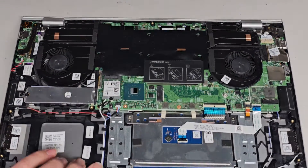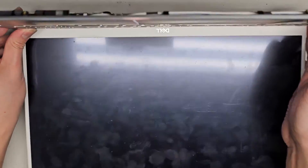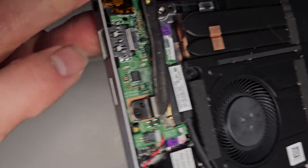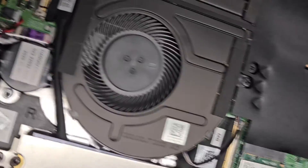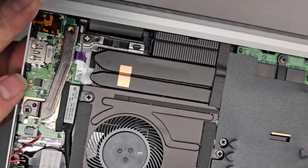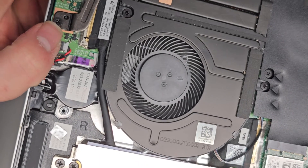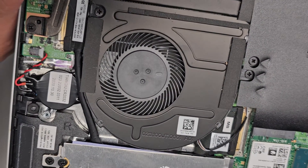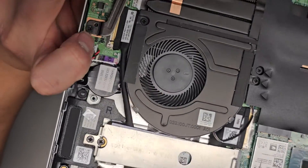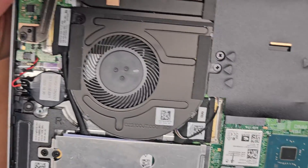After removing the battery, open up the laptop and press and hold the power button for 15 seconds. While I'm holding that, let me look at what's inside. There's a little purple and white cable going over to the side here — I'm not too sure what that is; it might be a hall effect sensor, the thing that tells it that the screen is closed. There's nothing connected to it. You've got the CMOS BIOS RTC real-time clock battery right there — CR2032 with a cable. Take note of which way the connection is going: the black wire is going up towards the hinge, the red wire is going down towards the opening of the laptop. Make sure if you get a new one, the wires are going the right way. I'm pretty sure I held it way more than 15 seconds.